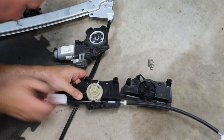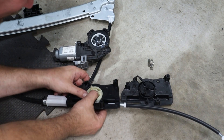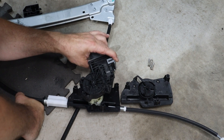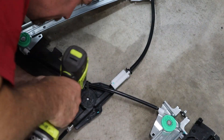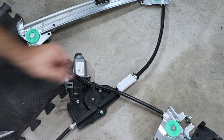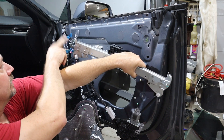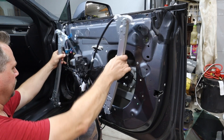There's a zip tie to make sure this thing doesn't fall out, so I'm going to remove that but also make sure it doesn't go anywhere. Now I should be able to install the original motor into our new assembly like this. All I really needed to do was line up the screw holes, flip it over, and put the screws in. The top has the threaded rods coming horizontal, and the bottom has the ones going vertical — those go down through the bottom door.